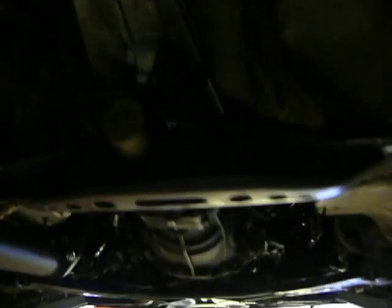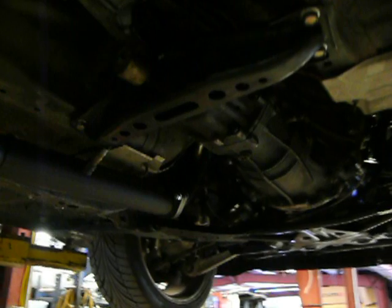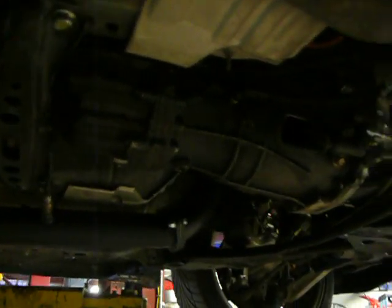You can see the transmission, which is very unique. It is not the 350Z transmission - that is an SR20 DET with the slave cylinder on the passenger side. We made a custom clutch line to go around the front.